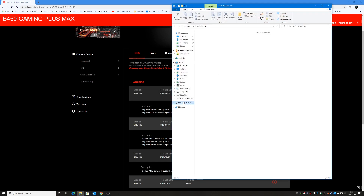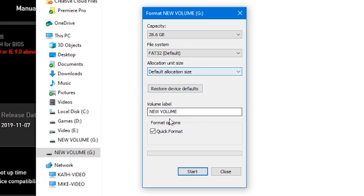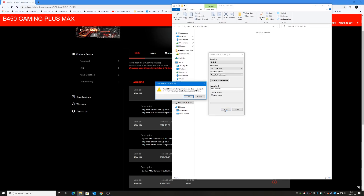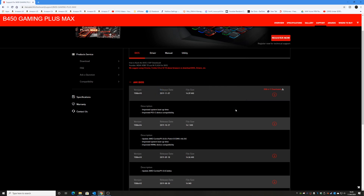The first thing to do is to format the drive. Go into the format section and format it to the full capacity and choose FAT32 — this is very important. The allocation size you can set to default, and provide a quick format. You'll get a warning to say that anything on the disk will be erased, so make sure there's nothing on there you need before you do this. Click OK, and that's it — pretty straightforward.